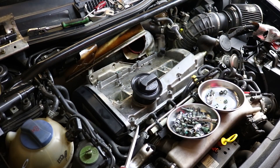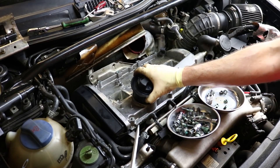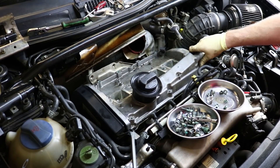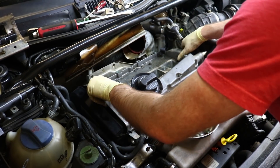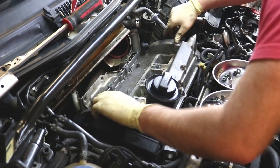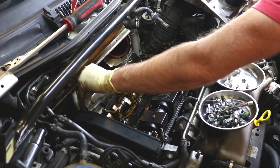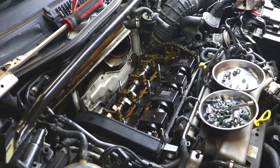We're going to take this big screwdriver and pop up from here right underneath. If you get resistance when you're doing this, then you know you maybe don't have everything off. We're going to pop that up and you should see it kind of loosen up everywhere along the way. Now you'll see a wiggle, but you're not going to just have it fall off because of the way it sits on these studs. What you're going to want to do is kind of wiggle it back and forth and work it up. I did have to get a screwdriver and bend this back just slightly, just a tiny little bit, and we got our valve cover off.